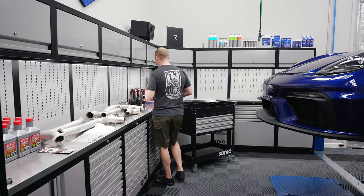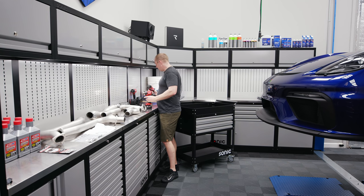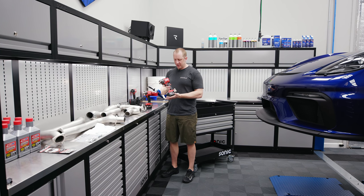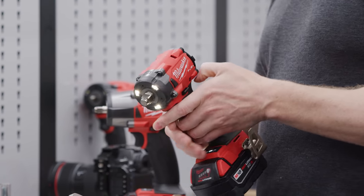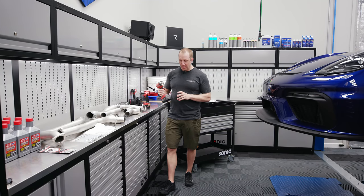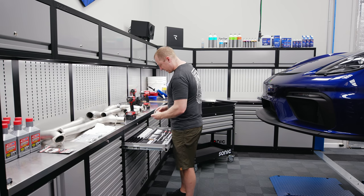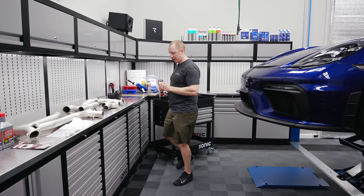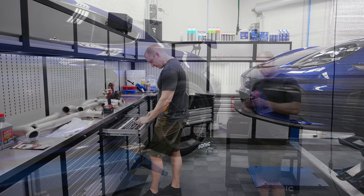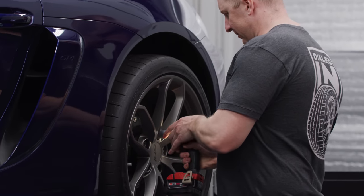First thing we need to do is pull off the rear wheels. I don't think I need to take the rear bumper cover off — I think I can just take the diffuser off. I want to try this brand new version of the Milwaukee — this is the mid torque and this is the compact torque. I'm still waiting on the half-inch version. This is 3/8, this is half inch. It says 250 foot-pounds of nut-busting torque, so let's see if it'll break the lugs, which are torqued about 110 foot-pounds. I think these are 19mm.